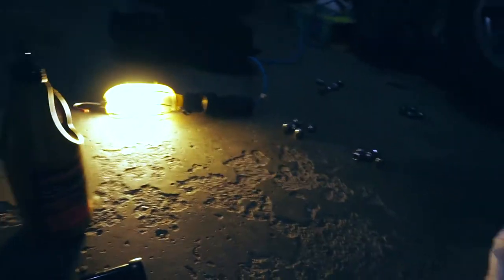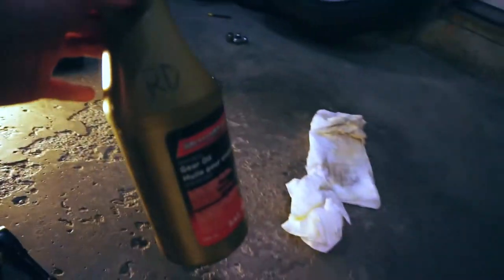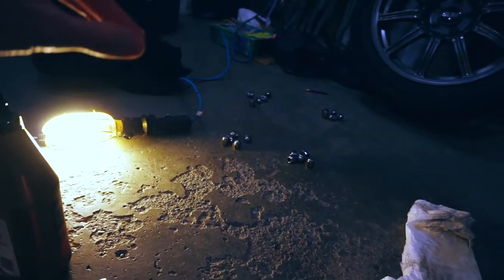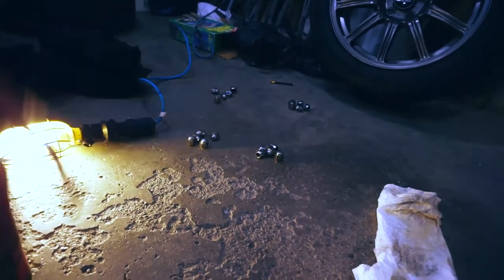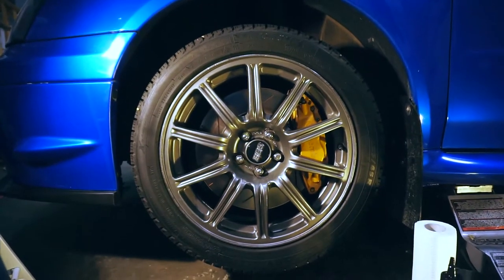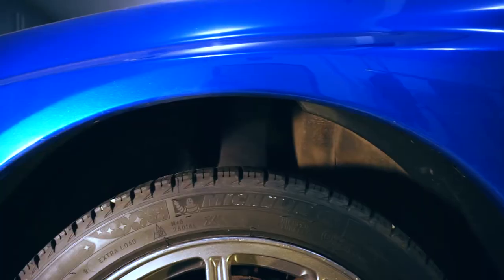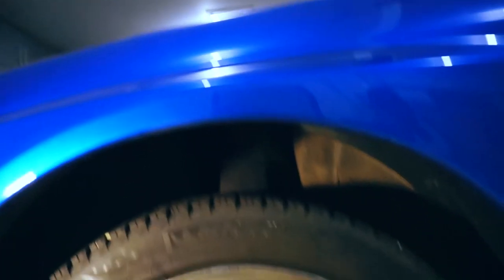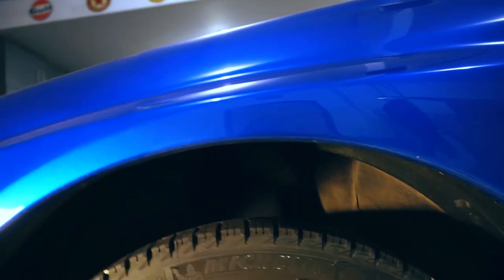Some people do this, some people don't - I just put a little tiny bit of oil on the wheel nut as I'm screwing it on just to make sure it's easy to torque and I get the right torque spec. And there we go, one winter tire on, three to go. You can see the coilover cover is on and it adds a nice little black hint, so if you have really bright coilovers it also hides those. I'll catch up to you once we're done and give you guys a little walk around of the winter tires.